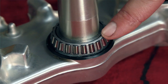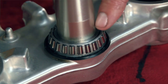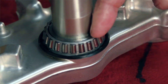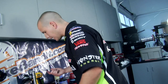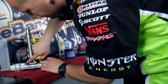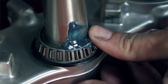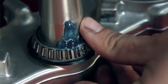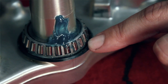As far as the bottom bearing goes, this bearing is pressed onto the stem so you can't take it off. It's a little bit more difficult, but the same principle. That opening right there is what you're going to try and force the grease into. Just take a small amount of grease and leave a little pool there. With your other hand, start forcing the grease down inside that lip. This is a lot more tedious and takes quite a bit more time than doing it in the palm of your hand, but it needs to be done. Make sure you get all the way around it until the grease comes out of the bottom.